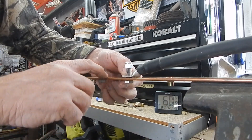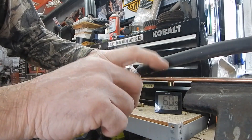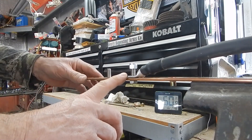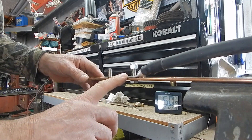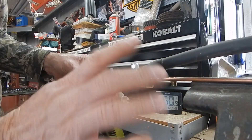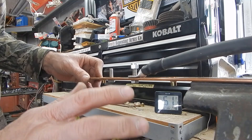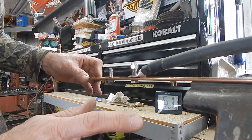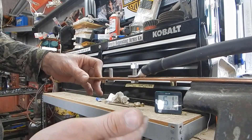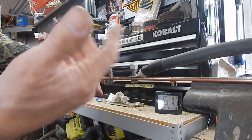That's how the lugs are going to go — bypass these crazy things that fell out. I showed you a little trick with the lock washers for the divots where the battery cables are going to go. Then I'm going to wrap this with 1-inch diameter shrink wrap, just put the shrink wrap over it — I'm not going to shrink it yet. When I get everything installed and the batteries are all hooked up, I'll cut the shrink wrap where it needs to be cut, shrink wrap the rest of the bus bar, and that'll complete the installation.